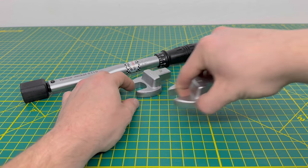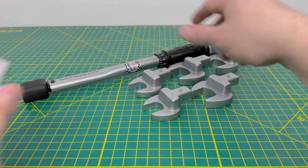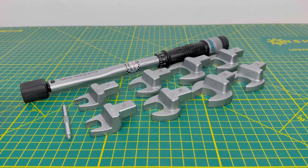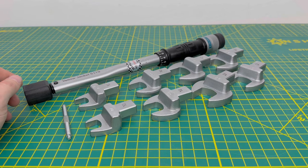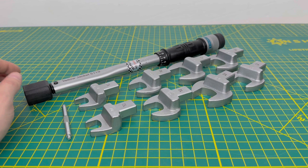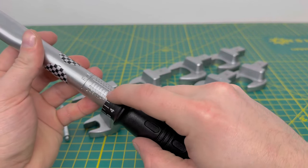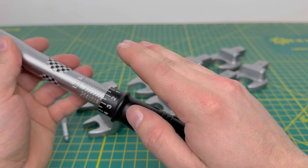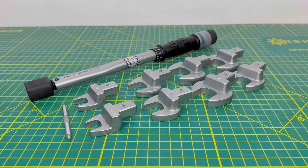Overall, this is quite the kit to have. I like it because it comes with all the different sizes so you have every head you'd need for flare nuts you're going to encounter, without constantly adjusting an adjustable-wrench style. I find it to be a little bit more accurate. The one downside is these analog wrenches have a learning curve — if you need 13 foot-pounds and your scale shows 11 and 14, you have to find that spot precisely in between. With a digital one you just dial in 13 foot-pounds and go.